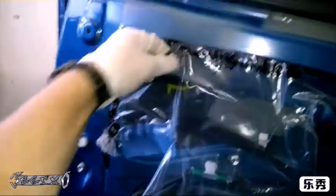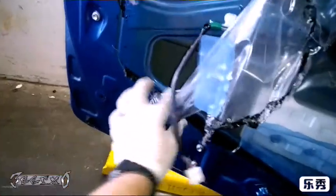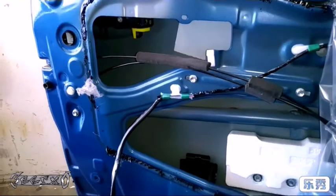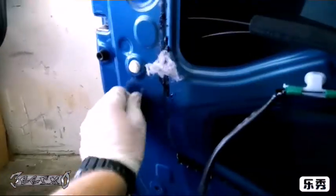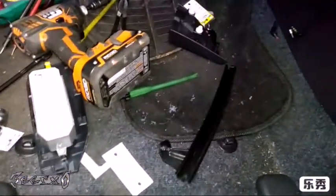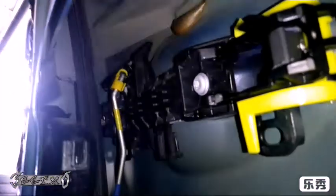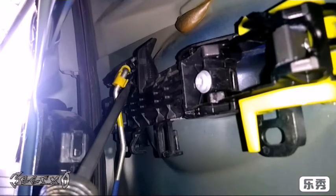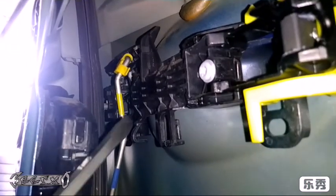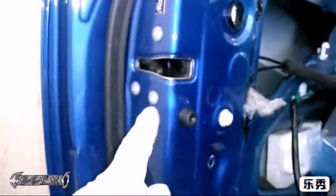I'm going to get the actuator out. Pull this plastic off - try not to rip it too much, pull it right where the glue is. This is just for sound dampening to keep the mechanisms from being too noisy. Take this 10mm bolt out - this is the window track. Pull it out, pull the rubber out of it, and pull this guy out of the way when you pull the actuator out. You'll put it back in afterwards. See that rod with the yellow connector on top? That needs to come off. Do not break it - it's really fragile. Get a flathead, go to the bottom part, and pull it loose or push it up.